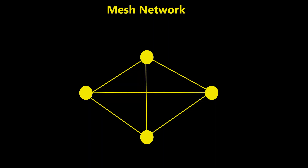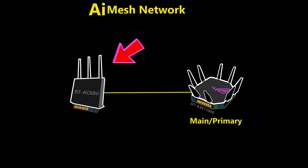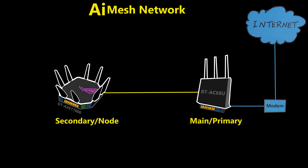Number one is probably the most obvious one, and I talked about it a lot on this channel, but still very important. In a mesh network that consists of routers or devices that are not the same model, for example in an Asus AI mesh network, it is best to use the most powerful and most advanced one as the main or primary device and the other one as the node or secondary device, because the main one is directly connected to the internet and responsible for most of the work. Otherwise, I might be overloading the weaker one while barely using the other.